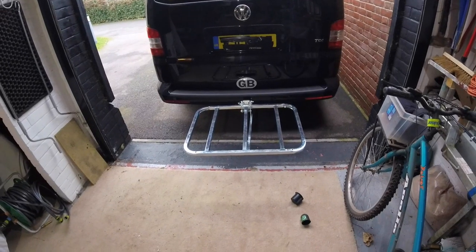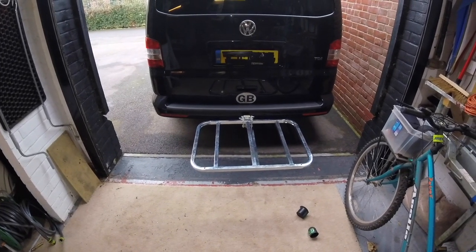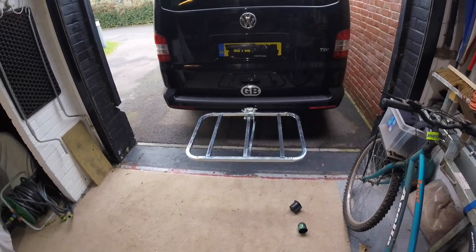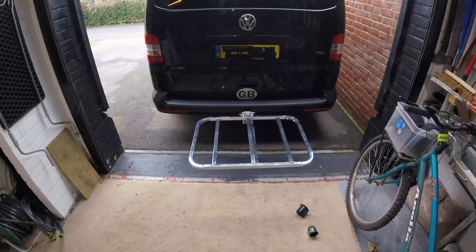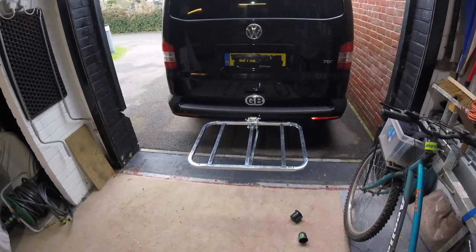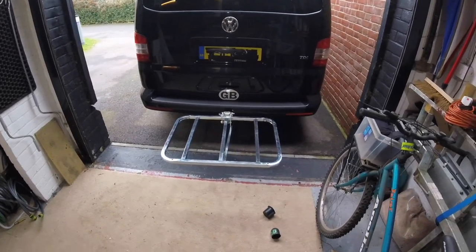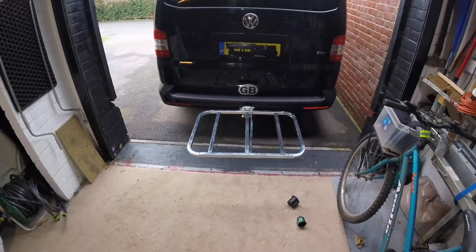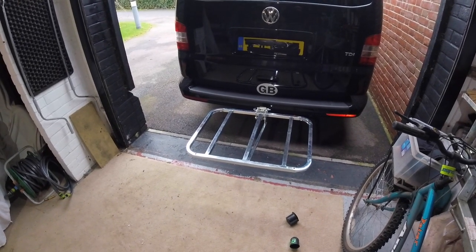Quick recap of the Backrack G3 system. I just wanted to say that I'm not connected with Backrack in any way, shape or form — I simply discovered this product by searching for alternatives to the Thule 949 Easy Base. As I noted earlier there are some differences: the Thule has a lower load rating but does come with a light bar. We opted for this product because we have a tow bar with a high nose weight and this can carry 100 kilos, so we decided to go down this route.